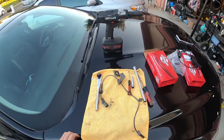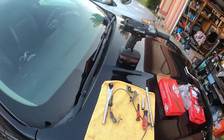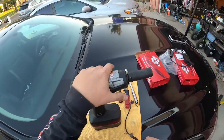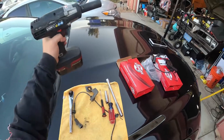Here's the tools that you're going to be needing. You're going to need a ratchet, an 8mm, a 10mm, a big screwdriver, a little screwdriver. This is completely optional, but you could use an electric impact wrench and you're going to need a 19mm to take off the wheels and take off the one bolt on the stabilizer link.